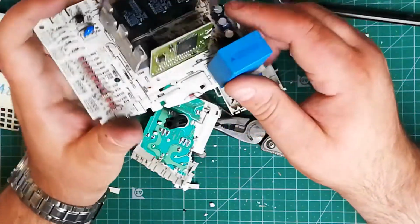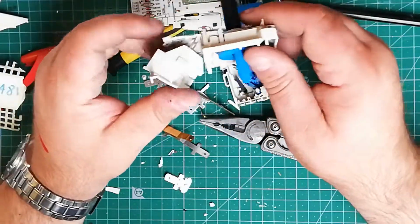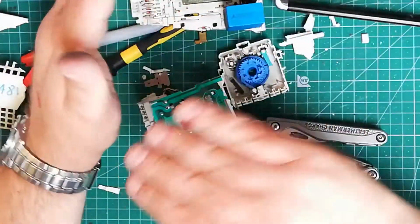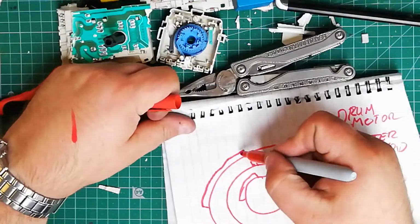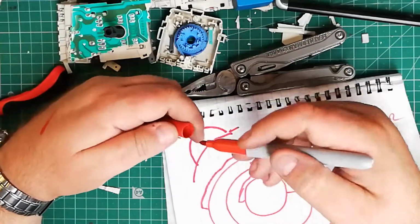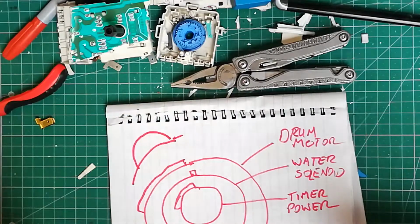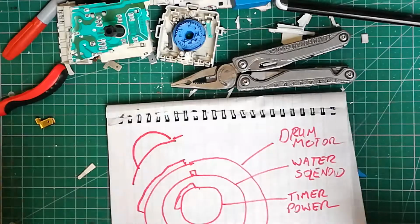But as I was saying about the water jets, there is a city over there, and they had these water jets installed about 10 years ago, but they actually use a cam timer for controlling the water pumps. The cams are actually sloped, so instead of a sharp drop-off, they're more gradual, and as the contact goes over it, it changes the speed of the water pump. The cams this system uses are good quality. I think they're Kevlar based, and they can switch out different cams for different times of year.